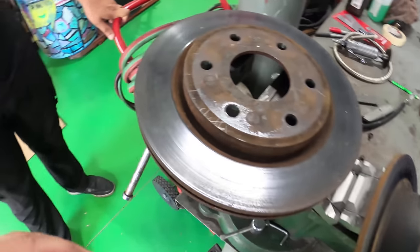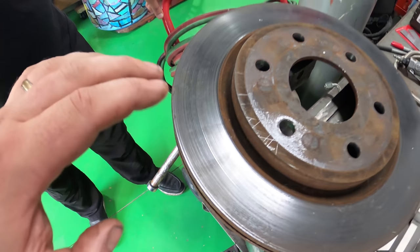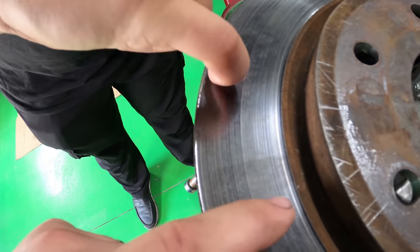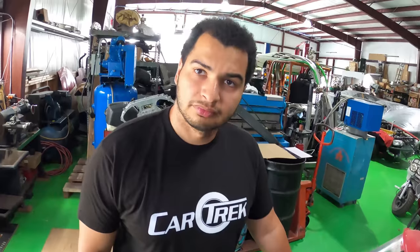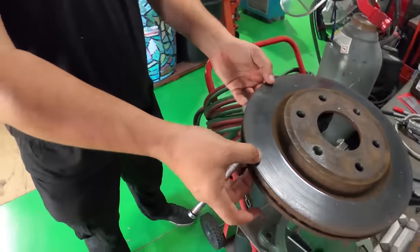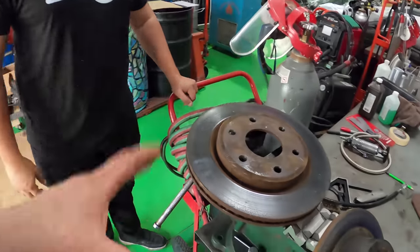When we talk about turning a brake rotor, you machine and make the surface flat again and ready to accept a brake pad. You could just pad-slap it, but if you look, there are very small ridges on the surface — so until your brake pad wore into this pattern, you'd only have about 40% surface contact. And 40% is not 100%, and it's not good. Since you obviously need as much braking power as possible, do you need to worry about how thick this is? Yes — there is a minimum thickness spec.